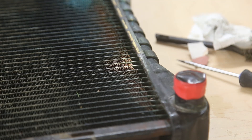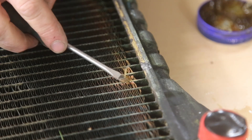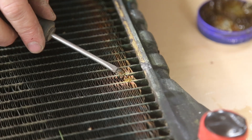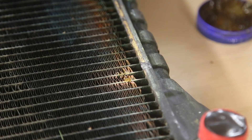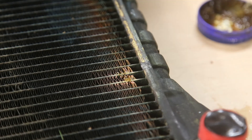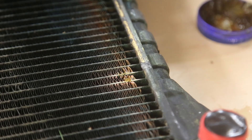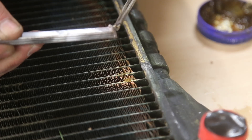Okay, let me get rigged up here and see if we can solder that up. So you can probably see the holes there, and I got one on that side there. I'm just going to put a little bit of paste on. Now I'm going to use lead. I'm going to use my soldering iron to try it first, simply because we're so close to the tank and if the guy gets a little too hot there, you sure don't want to start melting the lead around your tank — that wouldn't be too good. I'm trying out some lead. This is given to me by a fellow that does some auto body with lead. Lead melts at a little bit lower temperature — I'm pretty sure it does. Give this a shot.